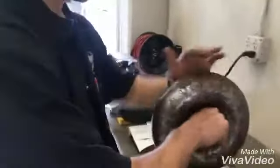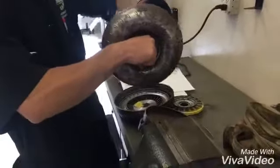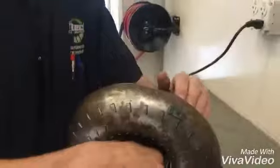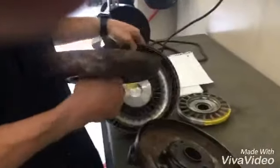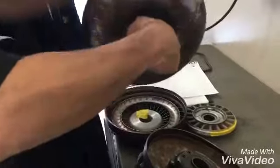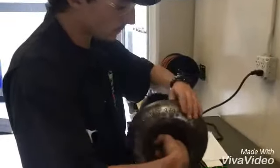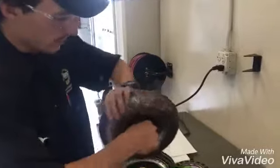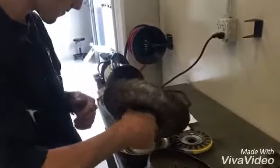The second phase is acceleration. You take your foot off the brakes, freeing the turbine from any forces besides friction of the gears and tires. Then you hit the gas pedal, spinning the case, pump, and impeller fins faster. As you throw fluid faster it gets thrown over to the turbine, the stator angles it, and the turbine starts to turn. The impeller is always going to spin a little bit faster than the turbine, and because of that speed difference you actually get a torque increase — torque multiplication — at your lower speeds. The turbine has more torque and less speed than the impeller.